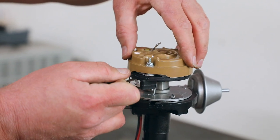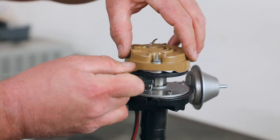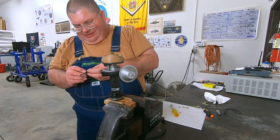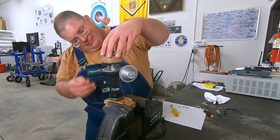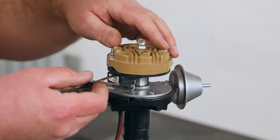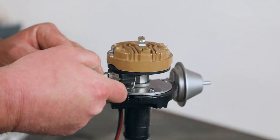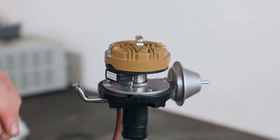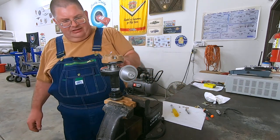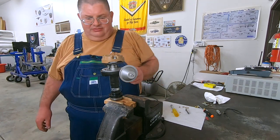Looks like right here is the tight spot. I think the magnet's grabbing the feeler as I'm in there. If you have a set of brass feeler gauges, it would probably be a little bit easier. I'm going to look for the widest part — the widest opening right about there. Twenty-four, let's go up to thirty. This particular distributor took one spacer washer between the magnet ring and the weights. So this is all ready to be installed back into the car.